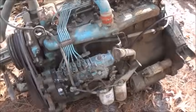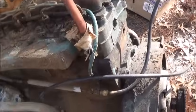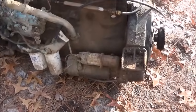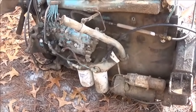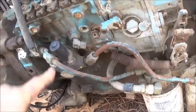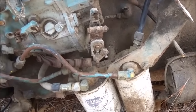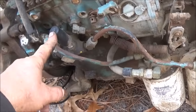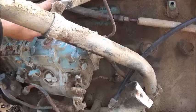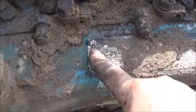Here's our 466 that we pulled out. It's a little dirty back here, but not bad. You can see somebody's redone the head — the engine's blue and the head's gray, so the head's been off at one time and redone. I like these pumps — here's your injector pump for your fuel. The other ones are on the filter housing like a DT466 MaxxForce, and I don't like them. You can pull this bleeder out right here, pump it, and get it bled up as close as you can. This thing fired up really good and ran really good even after sitting for years.